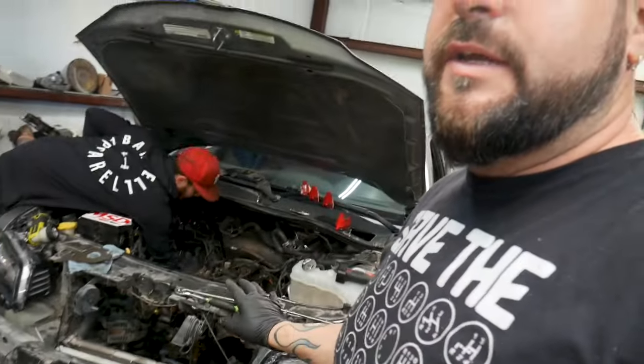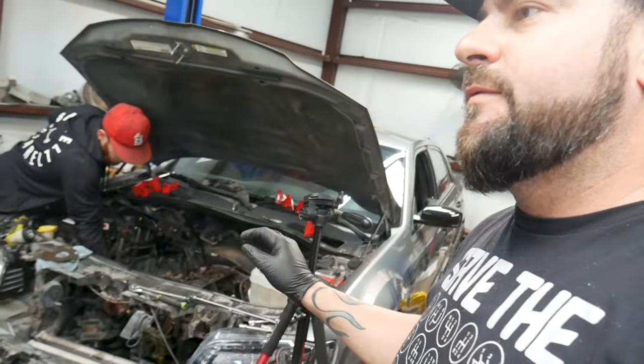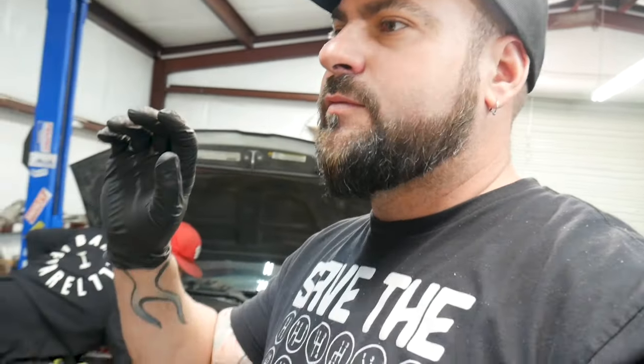Alright guys, it's Friday and we are wrapping up the week. I know it seems short, but I just haven't been picking up the camera — but we've been rocking and rolling. We've got motors laying around all over the place. This one's about to come out — the cam job you've seen Geo working on. We're going to pull the motor all the way out, take the pan off, and check everything over to make sure there's no debris or trash in the system. This one had one of the worst lifter failures we've seen: the roller was completely gone, the lifter had been burying itself, and it totally disintegrated the lobe on the camshaft.